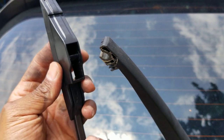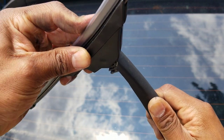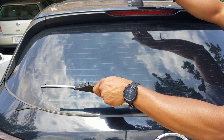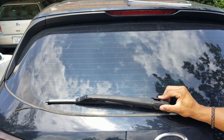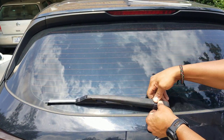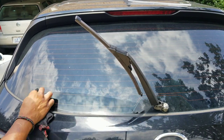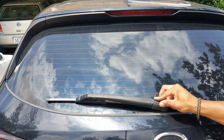This crescent here receives this rod that goes across it there and it's on. I'll take off the plastic, set it down and replace this. There you go. Get rid of the old stuff. I'm going to wipe this down real quick — I just put some windshield wiper fluid on my little shop rag. There we go. Now we have a fresh wiper blade.